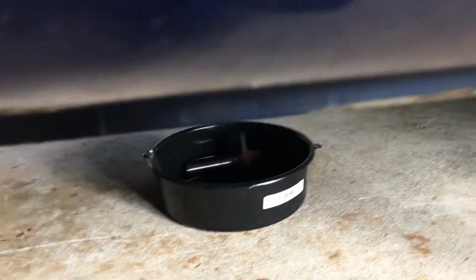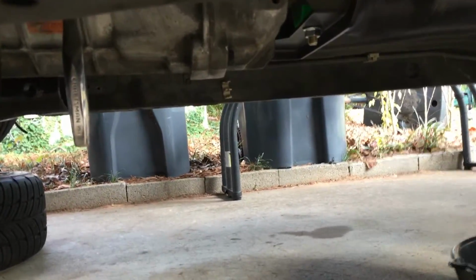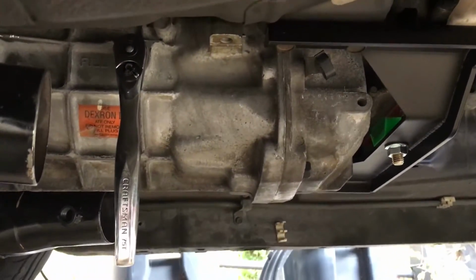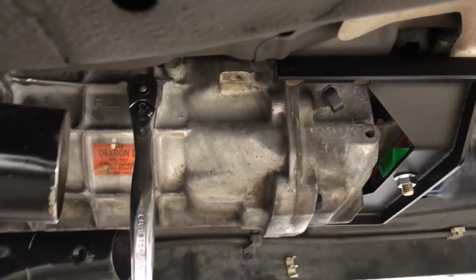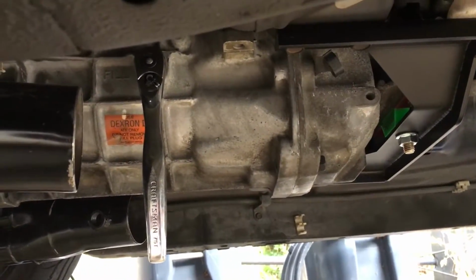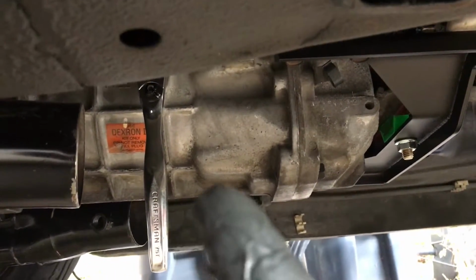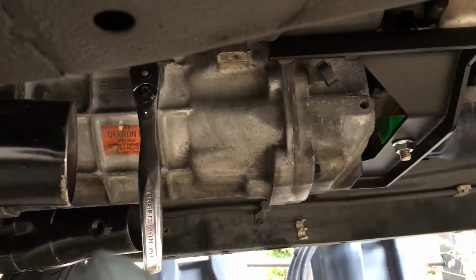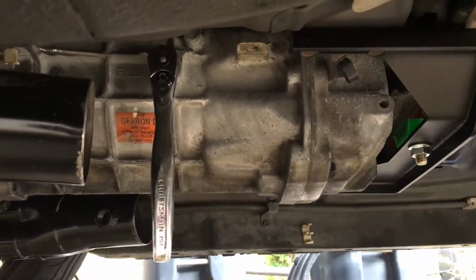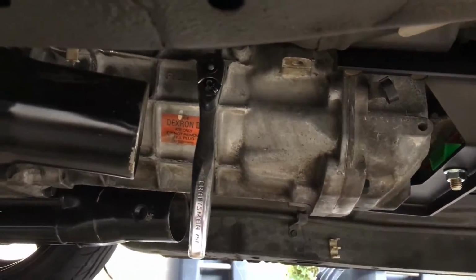All right, well, because I had an idiot moment and got too excited about getting the engine in, I never changed the trans fluid. So the difference between the T56 and the KA trans is about the fill plugs right here, the drain plug's over here, and they use a 3/8 instead of a half. So I'm gonna make sure I can get the fill open before I drain it, and then yeah, let's get some new transmission fluid in.